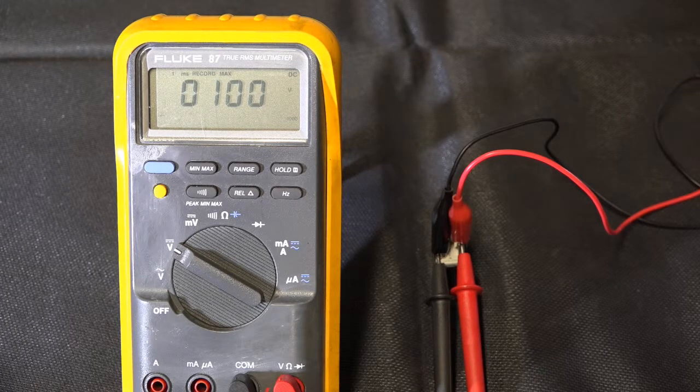That is definitely enough to hurt a driver of a computer, in this case the ECM or PCM driver controlling this system relay. So this is again a good way of testing to see if the diode was bad, other than using a test light. But again, probably one of the better ways of doing it is if you use an oscilloscope.